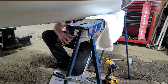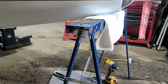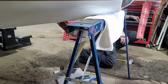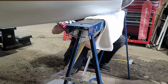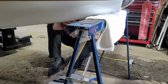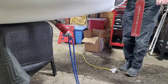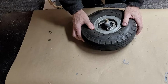So that's great. The clearance is correct at that lip at the front, and the down and up limit switches are working perfectly. The actuator is working perfectly. So I'm very pleased with this. It retracts into the correct place, and now that it's retracted, I'm going to take a whole bunch of measurements to determine the distance between the retracted gear and the outside skin, because I need to bond the front cover to it with a spacer so that it is flush against the outside skin. All right, now just to clean up the grinding at the very front lip.